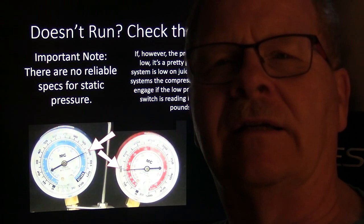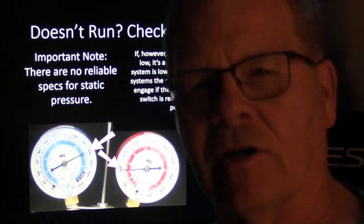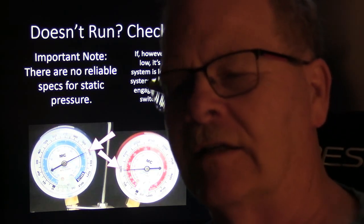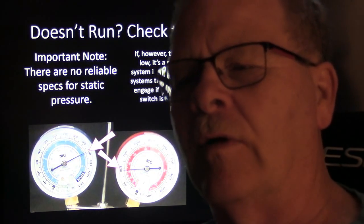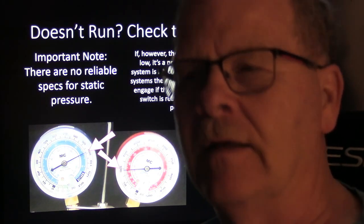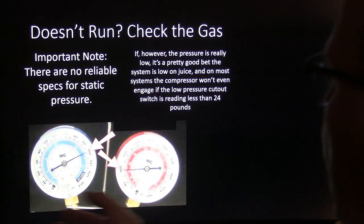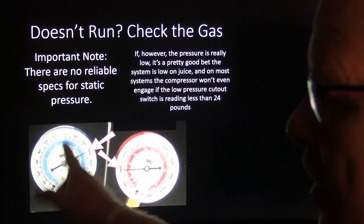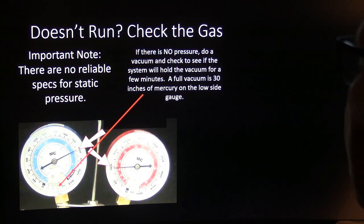Ambient temperature will make a difference on these pressures. It'll make a difference on the AC cycles, and it'll make a difference on how it cools. A vehicle that has an air conditioner that cools really good at night may have one that, in the heat of the day, won't cool worth a flip. So ambient temperatures have a tremendous impact on how the AC works and what the pressures are, because the pressure and temperature are connected to one another. All right. Okay,